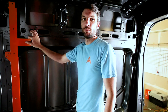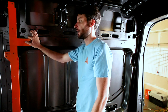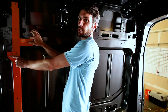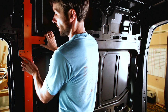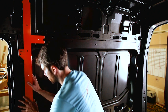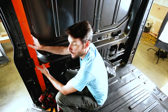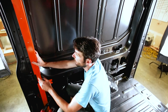Moving over to the passenger side of the van — it's basically the same procedure as the driver's side from the back of the sliding door aft. The pieces are mirror images of each other. Starting with TH3, same principle: start with the indexing hole and line it up over the OEM hole. The piece fits into the window pocket just like the other side. Moving down, same little tab with an index hole, drilling out the rivnut holes, setting the top one first, then repeating the procedure for TH3.